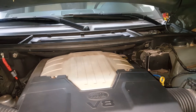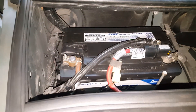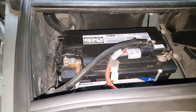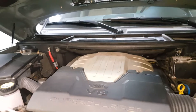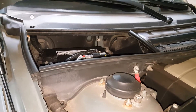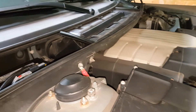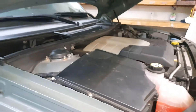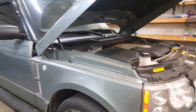What I decided to do was change the battery — I had one laying around from a different project. I went ahead and changed it, and that was about four to four and a half months ago. Since then I have not had that issue. What that leads me to think is that a cell in the battery went bad, causing it not to have enough voltage at starting, and it just doesn't let the ignition system work. Once I changed that battery, about four months now, I haven't had the issue.